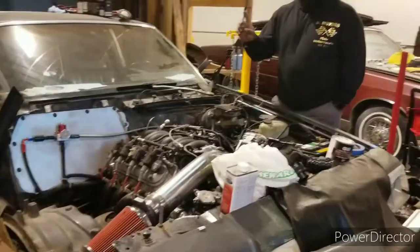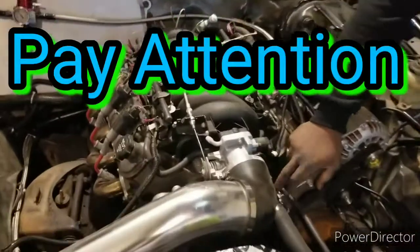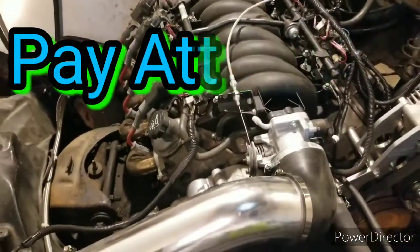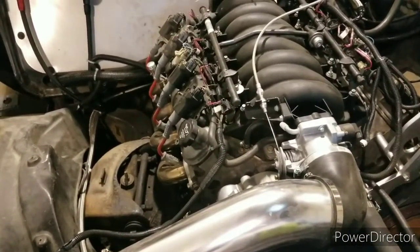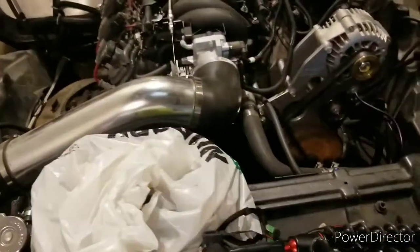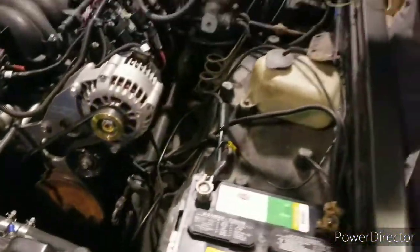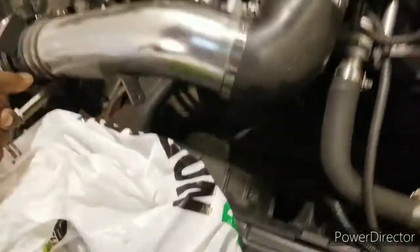On this one, I do have a little trickery here on the water pump. This is a 2010 LS3 water pump — no spacers, just bolts right up. You have many options: you can go with the LS1 with spacers, or people drill and tap the spacers. Some radiators give you a provision where you can run that steam vent too.